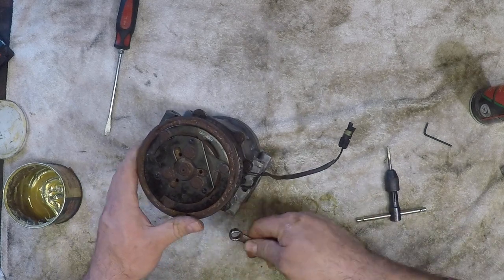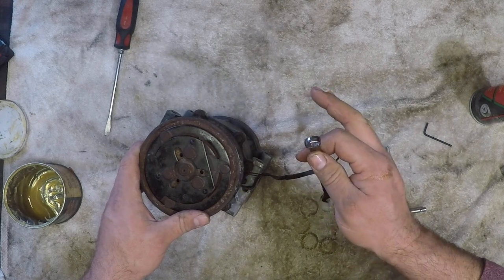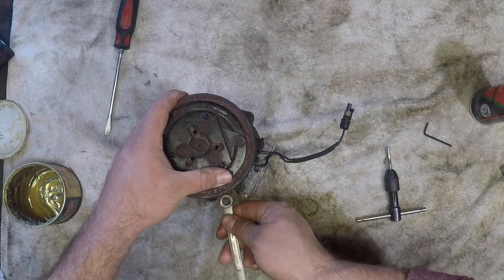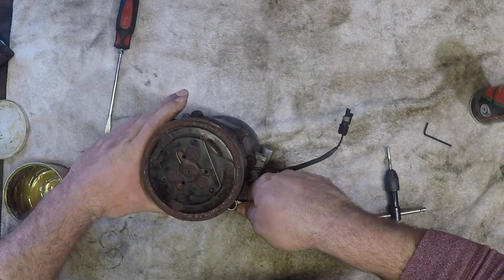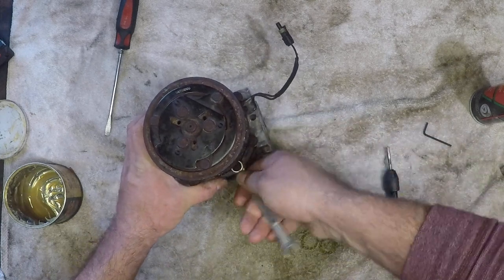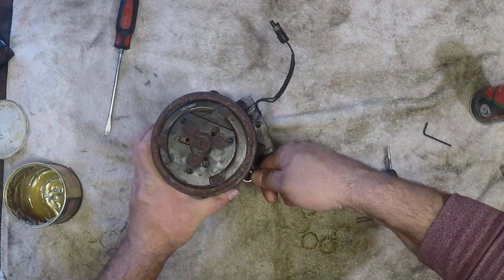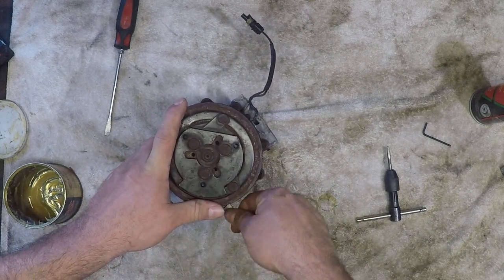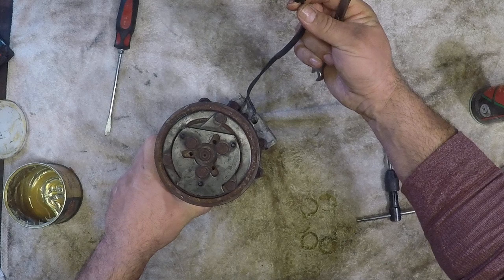Again, this is an air conditioning compressor — essentially nothing more than a compressor — but it is capable of 350 pounds of pressure. You need to be very careful with that. You don't want anyone getting hurt, so make sure you use a blow-off valve. Maximum rated pressure I would go is 125 PSI — that's right on the borderline of what everything is rated for. Power tools are rated for 100 PSI. Use a good quality on-off switch inline — run your wire from your switch through the on-off switch that's inline with the tank, then run it to this wire here. 12 volts DC is all you need.